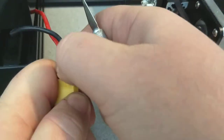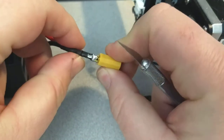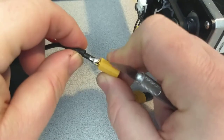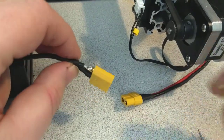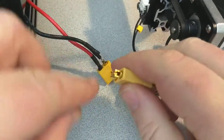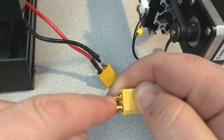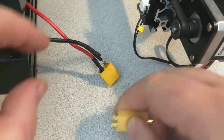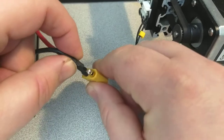So first thing I'm going to do is pull this off and take a look. Mine are indeed soldered — they're not crimped. The way you can tell is, see the way this is half-moon shape here? This is still half-moon shaped, hasn't been crimped around, and it's full of solder.